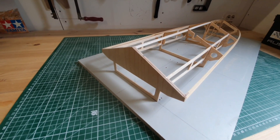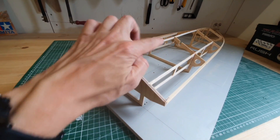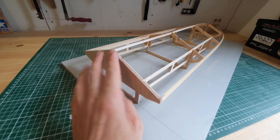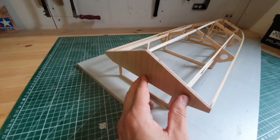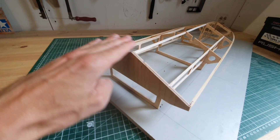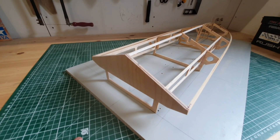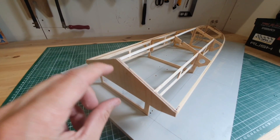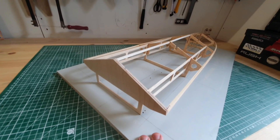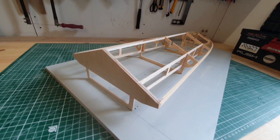The other option is to use dual struts like a hydro uses and riggers. The dual strut setup has the advantage that you can basically set up the strut to exit already at the bottom. The strut can extend below the transom. For twin drive that might be a good idea because you can put the propellers in the same line with the water. The drawback of a strut is that it is more difficult to set the angle — you can set the height of the strut but the angle is not really affected by that. I'm still making up my mind on the setup. If you have some good ideas I'm open for your advice, so please let me know.